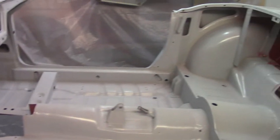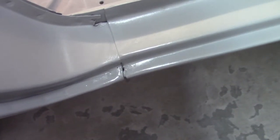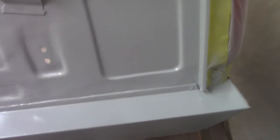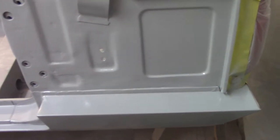For now the body I think is essentially done. I'm going to pause the body work on the body and move on to the body work on the bonnet. Here's a little close up of how those areas came in — they came in pretty well. A little too much filler in that spot there, kind of smoothed it out a little bit, but that's okay. I like the way that looks. I'll hit this with seam sealer. Even though this is all kind of beat up in here, there's still some dents and everything — I'm not going to concern myself. One, it's going to be covered. And two, I had replaced this whole patch under here, and this thing really took a beating while doing that. So I'm happy with the way that it looks.